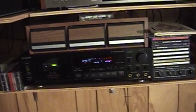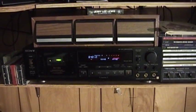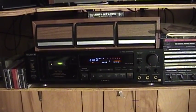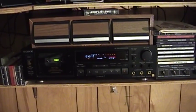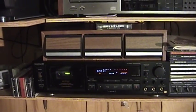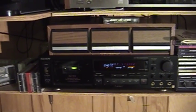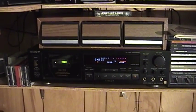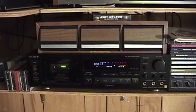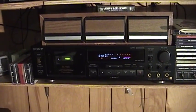The Sony's a nice deck and all, but I'd have really expected more out of something sold as a premium deck. When I'm listening with headphones I can just detect a little bit of wandering in the speed — it's just not totally dead stable. After it's been on for a while, it also makes a bad bearing noise; I suspect the cassette motor has a minorly bad bearing because it starts slightly squealing from inside. I may try to hit that with some penetrating oil, but it'll be difficult not to get it on belts. It doesn't seem to affect the speed, but it's annoying to listen to, so I don't leave this deck on a whole lot.